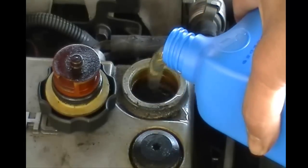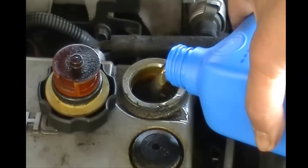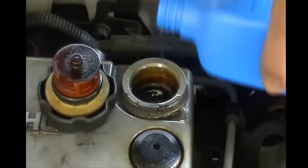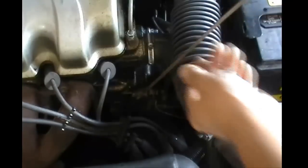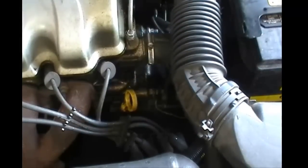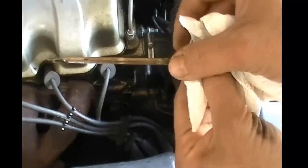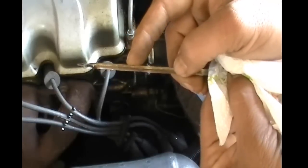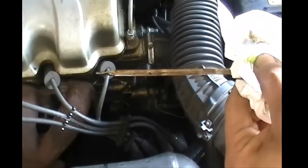You're going to end up checking your oil again — it's a simple easy process. Here I'm adding another quart; I'm not happy it was two quarts low. This is my son's vehicle and he doesn't know how to check oil — that's the primary purpose behind these videos. Now that you've added oil, put the dipstick back in after wiping it off, let it sit three to five seconds, then use a paper towel and look at your level. This happens to be perfect — right where it's supposed to be. If it's not, add a little bit more, put the dipstick in again, let it sit, check it again. You may have to do this multiple times to get the proper level. You do not want to overfill.